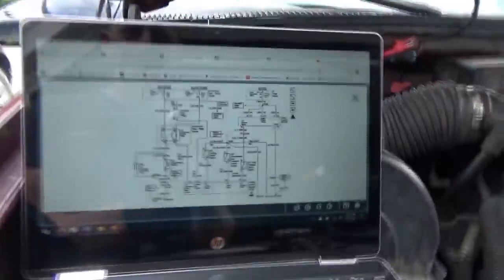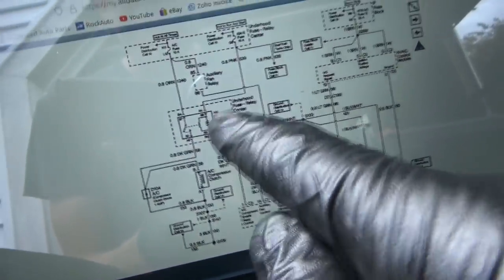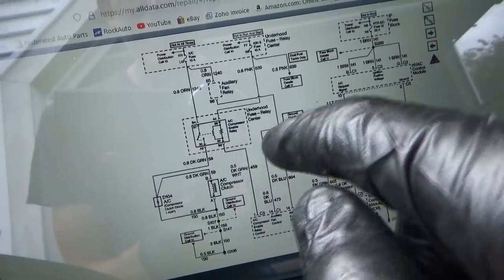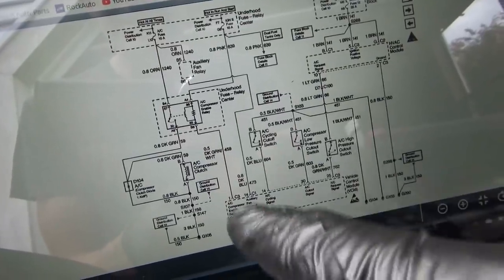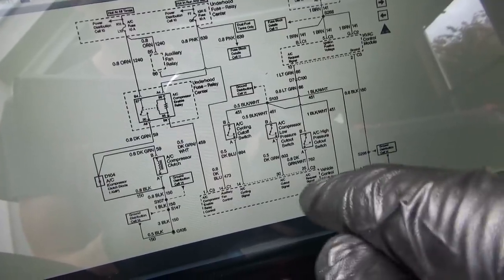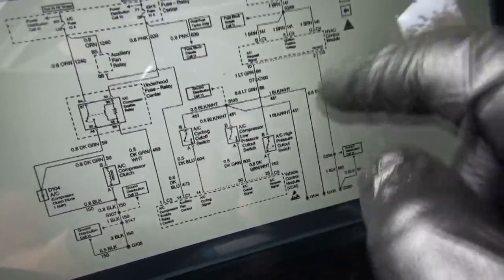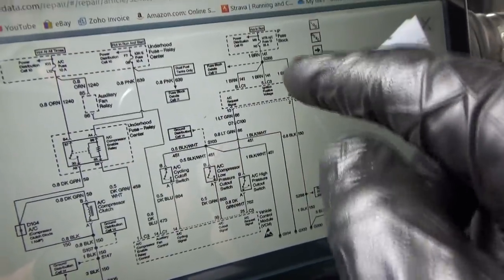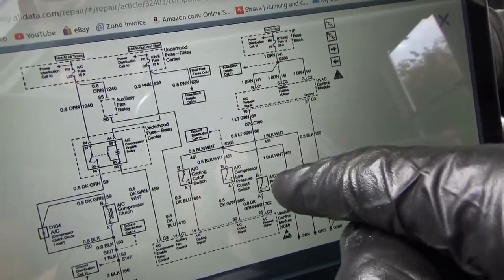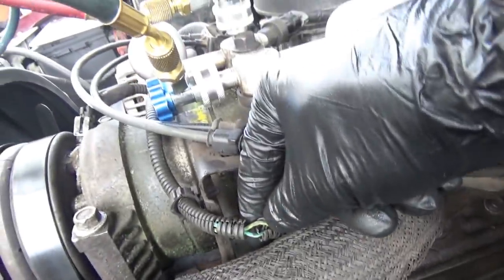This system is a little more complex than you would think for a '98 pickup truck. Here's the AC compressor clutch — it's controlled by the AC compressor relay, which is turned on by the vehicle control module. This is the PCM — that is actually the engine control module. The inputs to the PCM: from the HVAC control module, you press the button, and the AC request signal travels through the AC high pressure cutout switch and then to the vehicle control module. That switch is located on the back of the AC compressor — this connector right here — you can see the light green, dark green, and white wires.